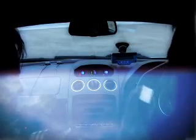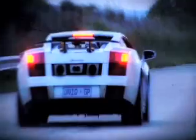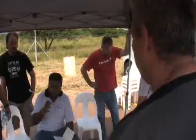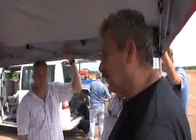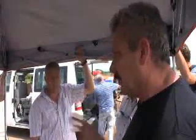I'm going to show you with the cell phone, and I can switch the backfire on and off. We can select high and lower power levels. Easiest to show is just the backfire on and off. On your cell phone, you've got those different formats set up, the templates or whatever. Just how many different? We've got one set of maps, which has 10 different maps in it for different things, for timing and fueling and boost control and extra injectors, whatever we want to do with it. But of those, we have 5 sets.